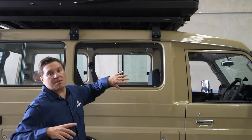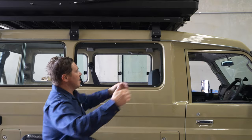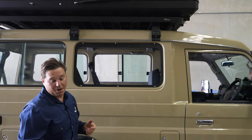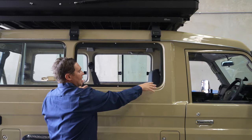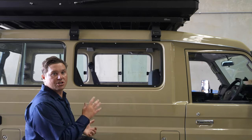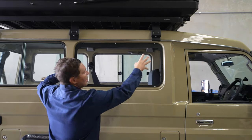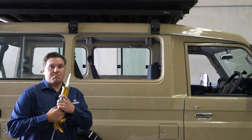The paint's dried. I'm chucking the backing plate on the front side just to check that the holes line up. It's almost impossible with a drill to get everything perfect, so I'm actually going to drill this hole and this hole out to six mil — it gives a little bit of clearance, doesn't matter at all, and allows all the bolts to go in nicely when I do the silicon. If you find a hole doesn't quite line up just give it a drill out, then when you put the silicon on and the gullwing goes on it goes on like a breeze.